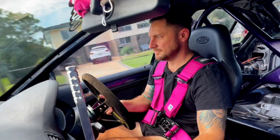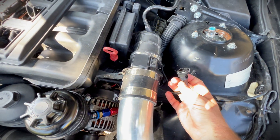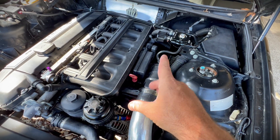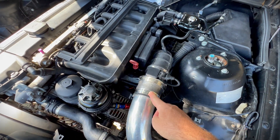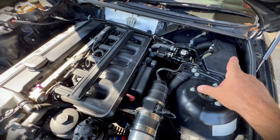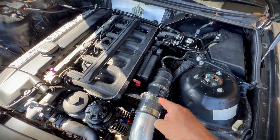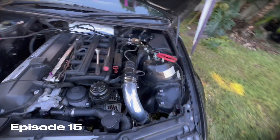Taking it on a little test run — feels pretty much the same as you'd expect, and it's hard to judge. One more thing to mention: this ECU comes with an Alpha-N base tune, meaning the airflow sensor is obsolete — it does nothing. Alpha-N tune uses the throttle position sensor reference instead of measuring airflow. One benefit is you can do away with the airflow sensor and have less restriction. Most factory ECUs will revert to an Alpha-N tune anyway if they lose reference from the airflow sensor — that's actually how I diagnosed my faulty airflow sensor back in episode 15.